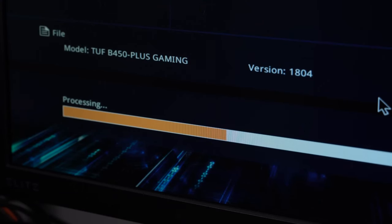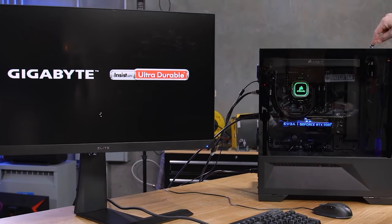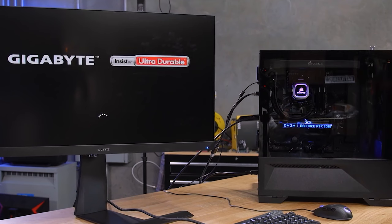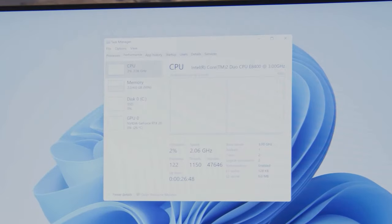And if you need it for a reason, it's better to wait a bit and see what changes they may have implemented. And by the way, Windows 10 and 11 are now able to adapt to new hardware that they detect, so you don't have to set up your new PC from scratch anymore. Just install your drive from your previous PC that already has Windows on it, turn everything on, and Windows will reconfigure and install all necessary drivers automatically. Yeah, you may lose your activation if you pirated your Windows, but in this case, you probably know what to do.